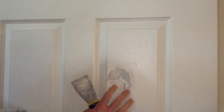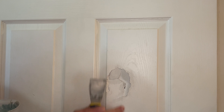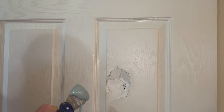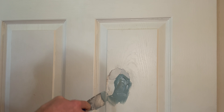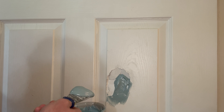I've let my caulking dry, and I've mixed up my Bondo body filler. I'm going to go ahead and try to smooth some in here, and I'd like to only do it once. When you mix up your Bondo, you get a limited amount of time to work with it, so you're going to need to do this pretty quick. The more hardening agent you add to it, the faster that it will cure.